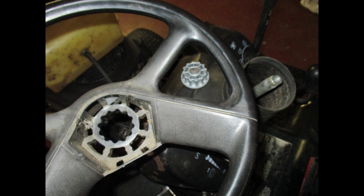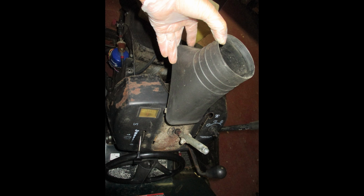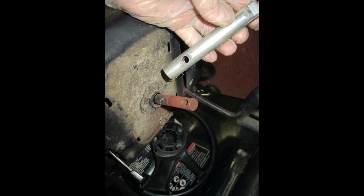And here you see the steering wheel aluminum hub adapter, and the steering shaft adapter that has 2 flat spots on it on both sides of the bolt hole. This plastic steering column cover just snaps onto the dash. Remove that. Remove the bolts you see here through the steering shaft adapter extension. Now you'll see the steering shaft adapter extension.